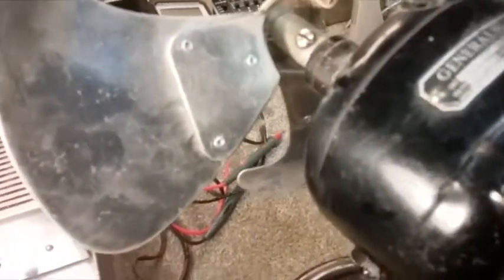I pulled this cover off and unscrewed the tension knob that engages the oscillation. We're going to turn it on with the Variac very slowly and see if we can find out where that noise is coming from. I have my Variac set up here. I'm not going to use the bulb for current limiting because I've already run the fan. I've got it on high. We're at 93 volts and it just starts running on high.